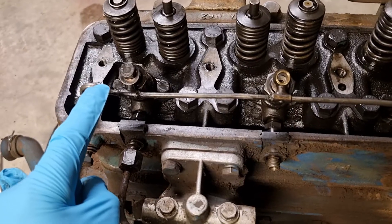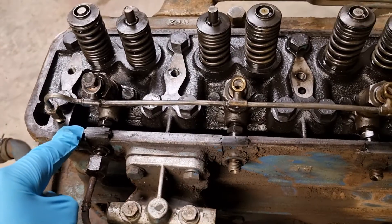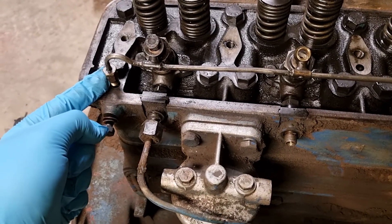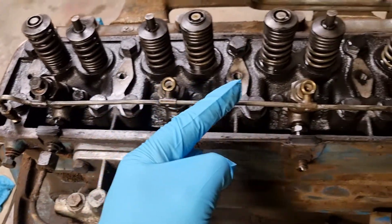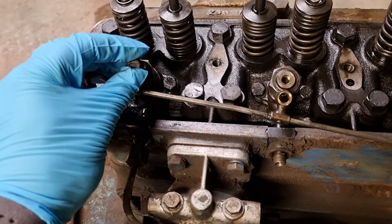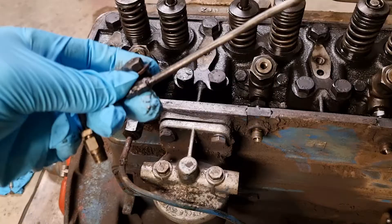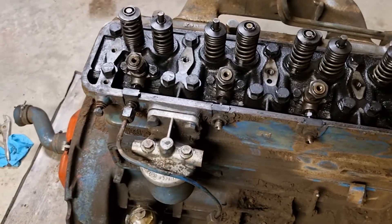Be careful not to drop anything into the engine, which is why instead of trying to do everything one-handed I'll leave it here. The first thing to undo is this fitting here, then you take it individually to undo the four bolts. They do have a washer as well, so something to be careful of. There we go — pretty simple. Leak-off pipe off, put that to one side.